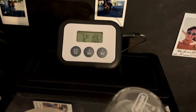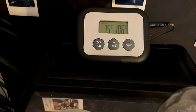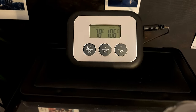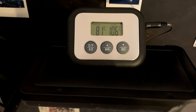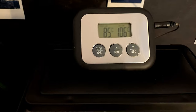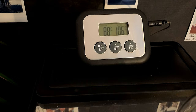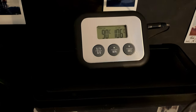The coffee brewing temperature should be 93°C — that's the ideal target, around 93–94°C. But in fact you're checking the temperature of the boiler metal, not the liquid. The liquid inside should be 93°C whenever the boiler reaches around 105–106°C. So this method gives you a pretty solid understanding of where you are temperature-wise at any given point.